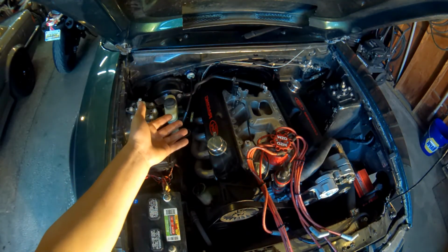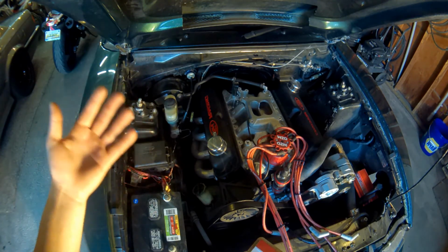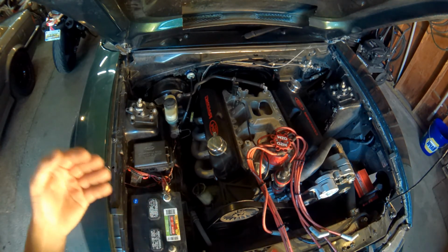And I found 4 bolts that were loose. That's more than enough for me to stop, and I know that there's bolts loose. That's most likely the cause of why we have coolant getting into the combustion chamber. And I'll show you more on the borescope of how coolant is getting into the intake runner.